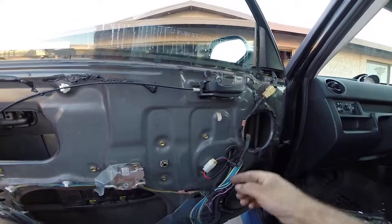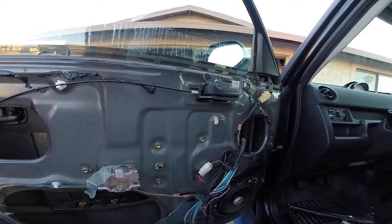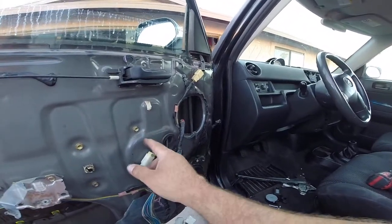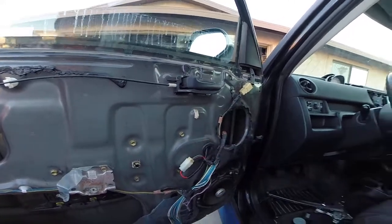And then you got to get it wiggled onto the gear mechanism. That's why I took it off here first, because I wanted to get the feel of where it was. And I actually did take the new one off of that mechanism halfway through taking this off, because I wanted to keep my arm in there, pull the one out, put it on the floor, grab the other one while I kept one of the bolt locations with my finger so I could get it located in there. It is a little bit of a chore to get it lined up. You may test your patience a little bit, but it is a lot easier than changing the whole lift mechanism. These mechanisms I don't think really go bad. If they do, it's the bushings, usually not any of the mechanics of it. So, but you use your discretion on that.